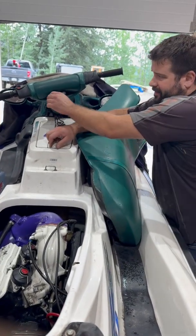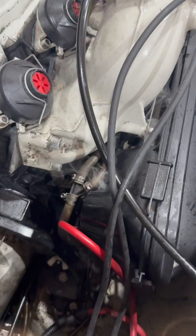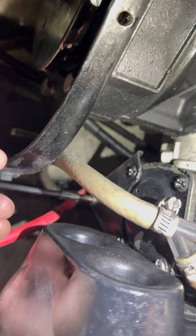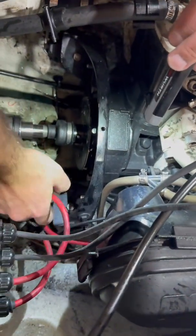I'm not going to hit this hard because it'll spray everywhere. What's happening down there? That's the cable burning — it's letting the smoke out. That's the power wire to the starter. It was sitting right on the throttle cable, so it was grounding out. So now we can try and crank it and see.